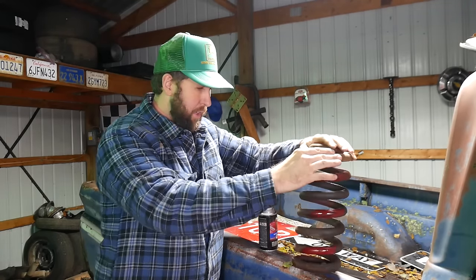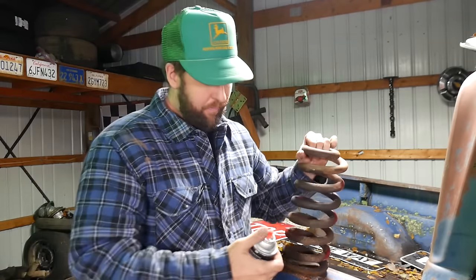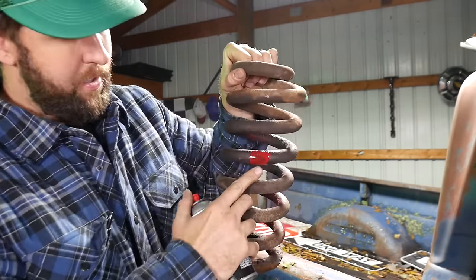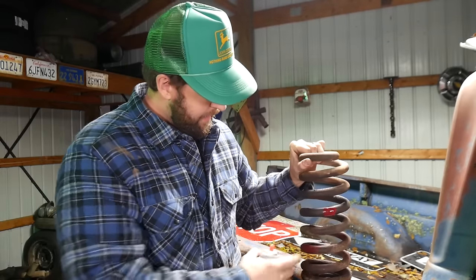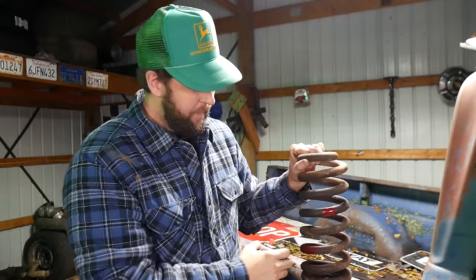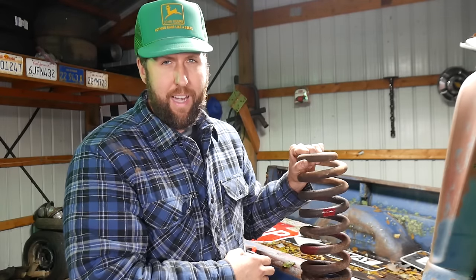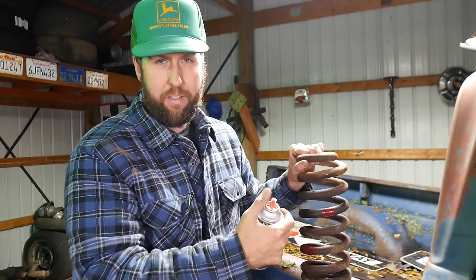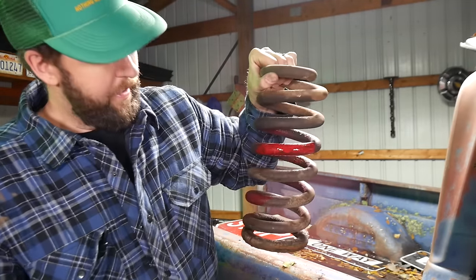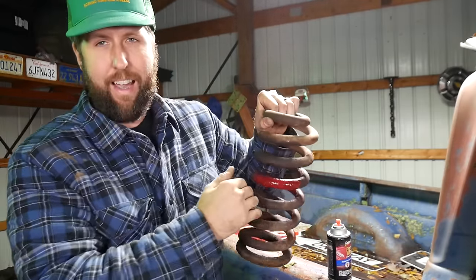The other thing that I want to show you with paint, a lot of people have the habit, because they use little bottle torches, they do this with heat. They just get a little section cherry red, and then that bends sharply down to get the right drop. But that's a fragile point now. She's more likely just to snap out of there when you do a little bit. So when you get your heat, you really want to drag it around like that. Heat up this section so it slopes down like that.